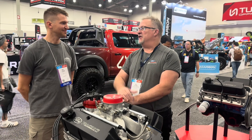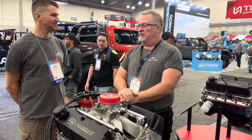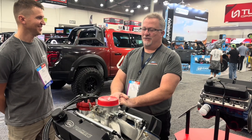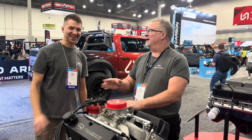That particular package on the 460, with the Z heads and the hydraulic roller camshaft, is a close to 600 horsepower idea. It's going to be awesome. Thank you so much — we're really excited.